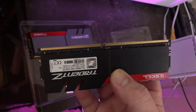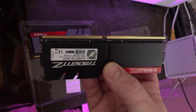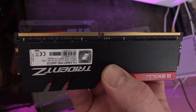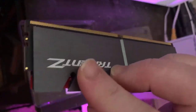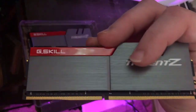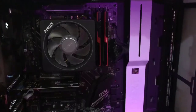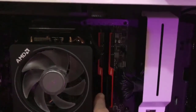So I think it needs to go in like that, and we have to populate DIMM A2 and then DIMM B2 first. So I'll pop these in and show you where they are, and then I'll do a screen capture of some games on the GT710. I will compare those same games to how they perform on whatever GTX card I end up getting. All right, moving forward. And there we are. You can see that they're in slot essentially 2 and 4.